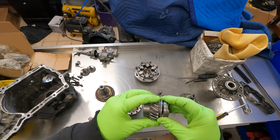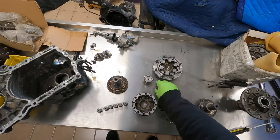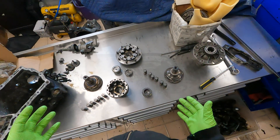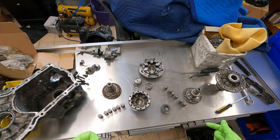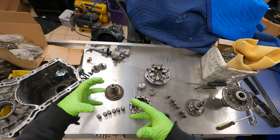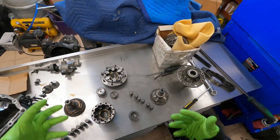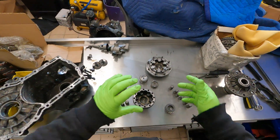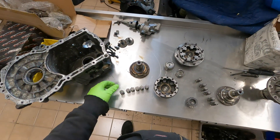There's a carbon fiber friction disc that gets forced hard onto the other side to act as a momentary clutch, coupling the two halves together. I've seen it in action — it will still spin the wheel with zero traction considerably faster, but it will get some power to the wheel that has traction and allow you to keep going. There will still be a good bit of wheel speed difference between the two, but it will in fact allow you to keep going — that's what's neat about them.